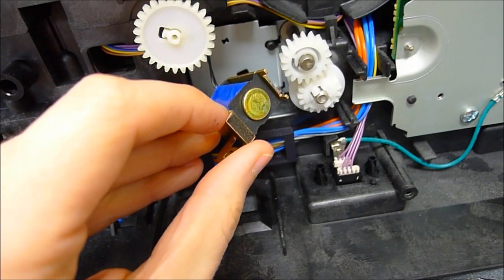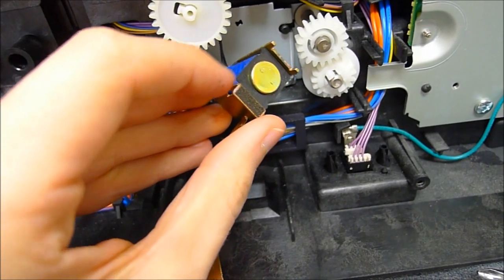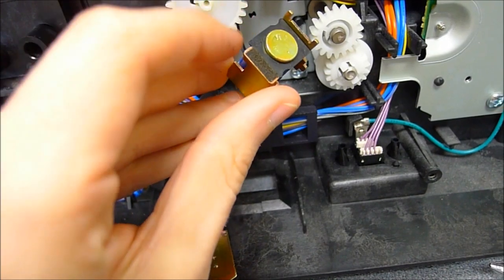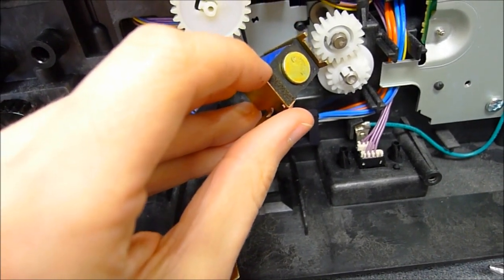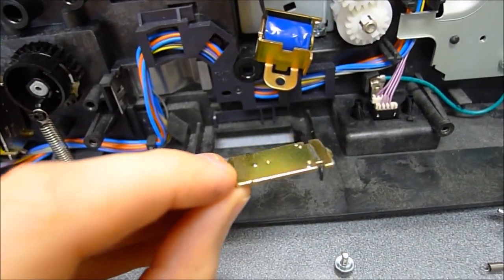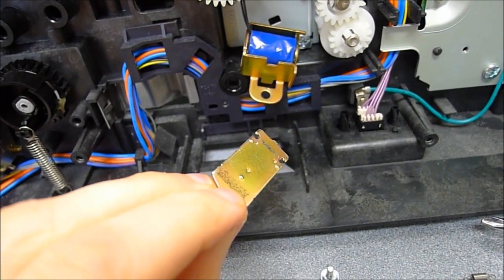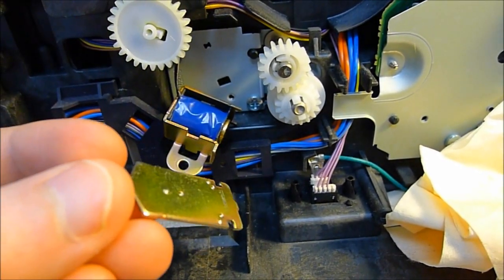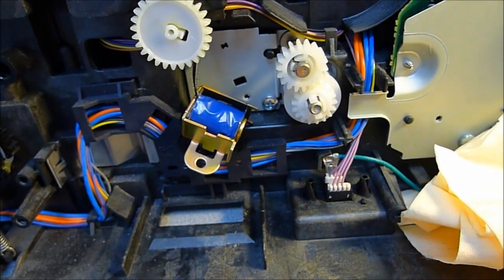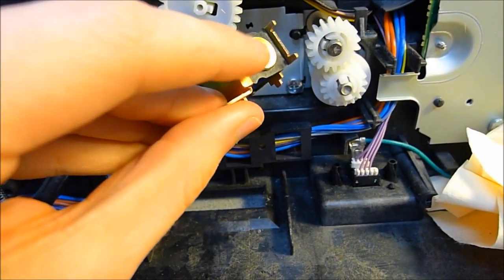You can replace it with something — maybe wrap some string or some sort of non-adhesive method — but really, for a printer this old, I'm just going to choose to leave it completely uncovered. It might make a little bit more noise, but at least we can be assured the problem isn't going to happen in the future. So we find some rubbing alcohol and a tissue and go to work on it. As you can see, we've removed all of the adhesive from the armature of the solenoid and also taken it off the body of the solenoid — you can see how clean that is.